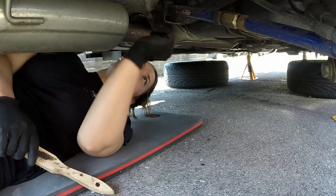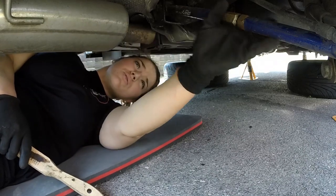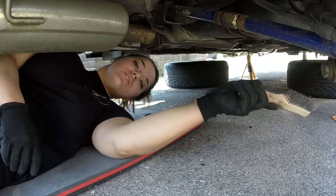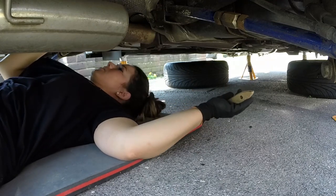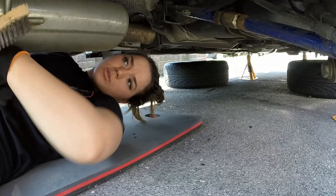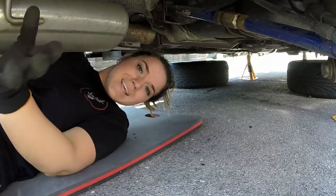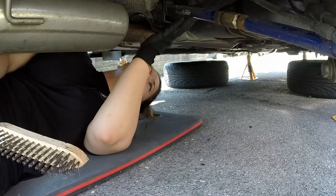There's some Bedford gravel still in there. I'd love to be able to get the subframe off, put new control arms on or just grease them up, put some upper control arms on and do the suspension - I know I need new suspension. I could potentially do the R56 aluminium upgrade on the trailing arms. When you get under a car you're like 'oh my god, there's so much I could do'. I also need to put some new exhaust hangers on because they're starting to go. I wanted to get the car up on axle stands to have a proper look, so I'm going to start scrubbing away now.